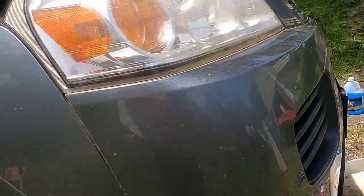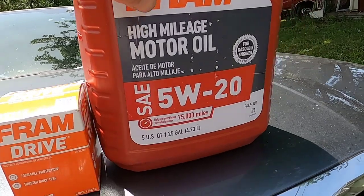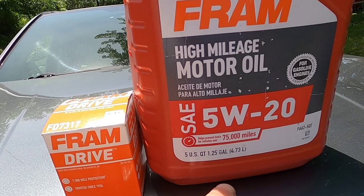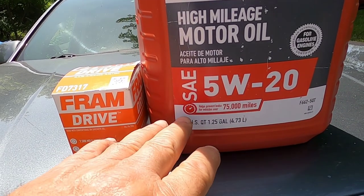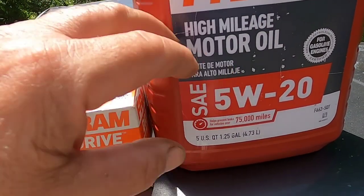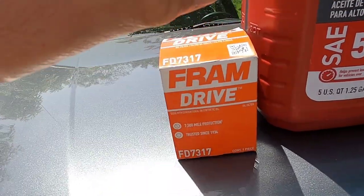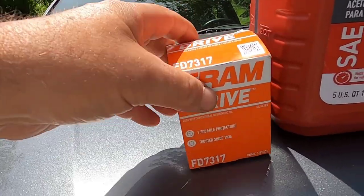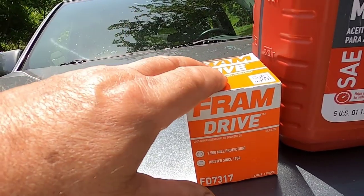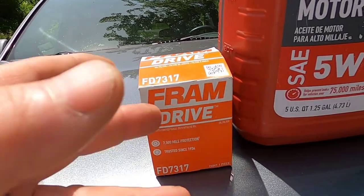Once the vehicle's secured, what you'll need is the oil and the filter. The manual on this vehicle says to use 5W20 synthetic, but the original owner always put regular oil in it and since I've owned it I've been using the same. Now this Fram filter definitely isn't the best you can get. This is what I was able to get delivered, so I took the Fram filter and I change my oil every 2 to 3,000 miles.